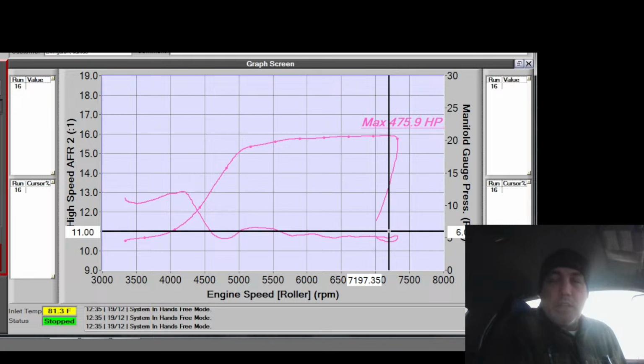Tipping is a little funky in that I've never had to run so little. Yeah. If you look at the curve right now, you see how flat that air fuel is compared to before. I had to undo all the stuff that I did trying to battle that fuel pressure issue or fuel damper issue. Now you see it's way more steady.